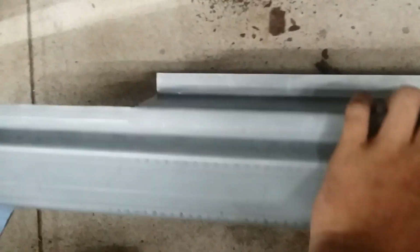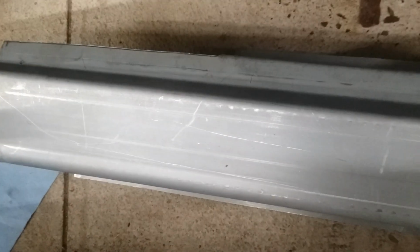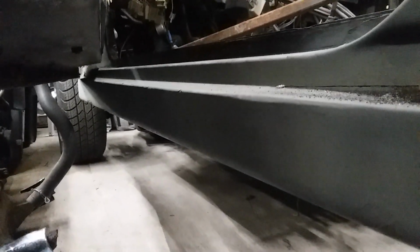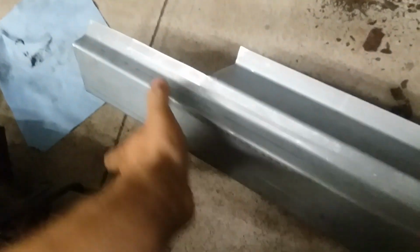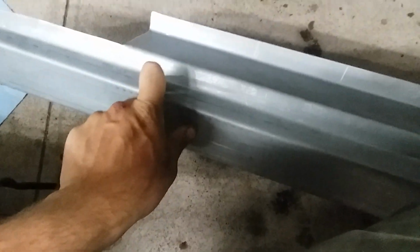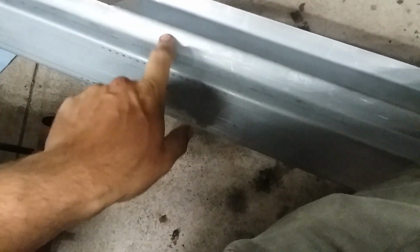And then on the top side, everything measures out fine, but they didn't do any of these bends right. They didn't finish bending them. This surface right here has to be completely perpendicular to this surface here, as seen in my car. You can see it's perfect, perfect 90 degree angles on everything except the actual sill. This is angled just a tiny bit so that water can flow out. That wouldn't be a problem if it was closer, but again, I'll have to take this over to the metal shop, and $5 a bend. I'd have 1, 2, 3 bends to do. That's $15 right there.